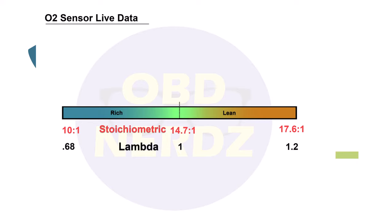Some of these values will show up on handheld meters — you may see stoichiometric values or it listed as lambda. Lambda is essentially the same as stoichiometric. The optimum air-fuel mixture is a lambda of one; as it gets lean that lambda value goes up, and as it gets rich the lambda value goes down. As shown in the chart, when it gets lean the stoichiometric value goes up because you have more air per unit of fuel, and vice versa.